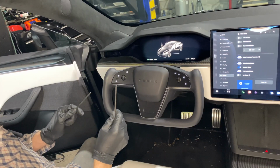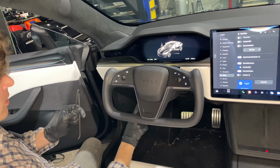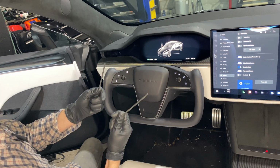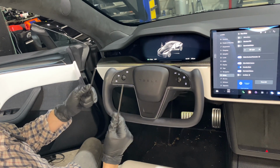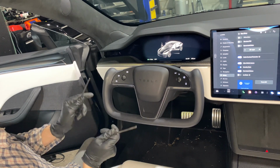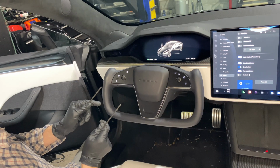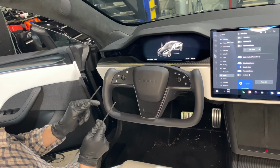Find the 2 small holes on either side of the steering yoke base. This is where you would stick your punches or similar tools to release the airbag module. Here's some X-ray vision of the angle and what is going on, because it can be annoying hunting around for the airbag release springs without being able to see them.